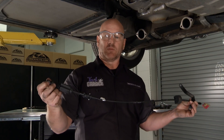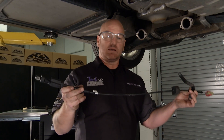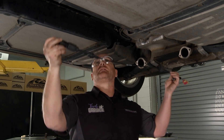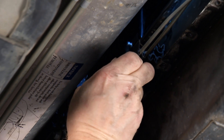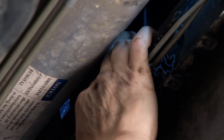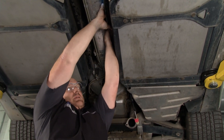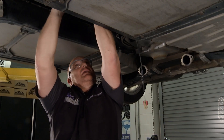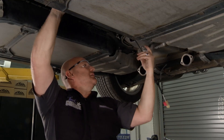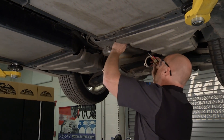The new cable is in and it's not all that complex — there are only five anchor points along the length of the cable. This job isn't about complexity, it's about access, so you've got to be patient. Think about all the plastic connections, and some silicone lubricant may help you get things seated. Starting at the bottom of the shifter linkage — that's the challenge — I'm going to send this cable up and use the bushing to help hold it in place. Roll it onto the ball and snap it in. Up above, you've got to get way up in here and seat it.